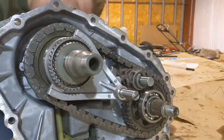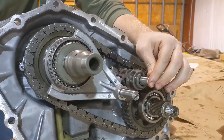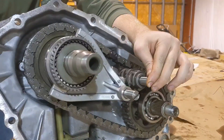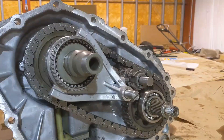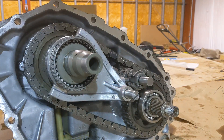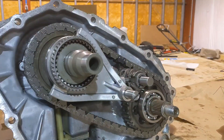So I'm going to show you a change into how you get into four-wheel drive high. We're going to turn this and you're going to see the gear be moved forward. Now we are in four-high. This gear has been disengaged from the planetary gear reduction on the face of the transfer case, but you turn it and your chain is still engaged, so you know that we're still in four-wheel drive.